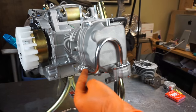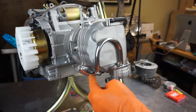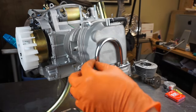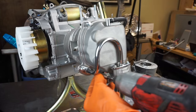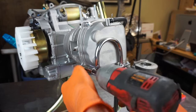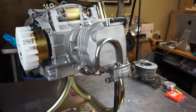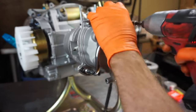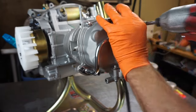I'd recommend blocking off the emission control because you're going to get some backfire on your exhaust with it installed. They sell little caps — we have them on our website, rollingwrenchdenver.com — or you can do it the cheap way and just pinch off the chrome hose with a pair of dykes. Then there are 8mm bolts again, and four on the head. Loosen those in a cross pattern.